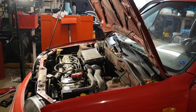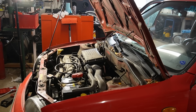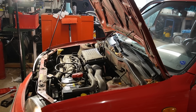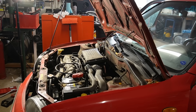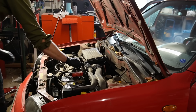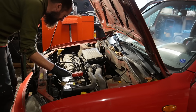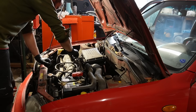We are not running on all four right now — we are running on three. But it is running. I'm gonna go ahead and buy some new spark plugs for this car. I think the spark plugs are the issue. The leads could also be changed maybe, but I actually think I did that not that long ago. The spark plugs though — I think they are fouled.